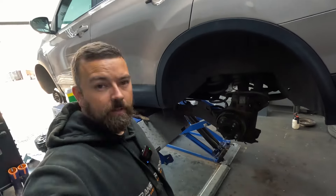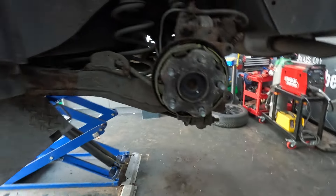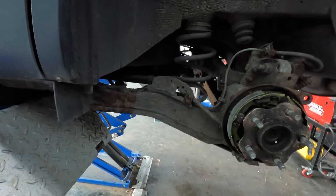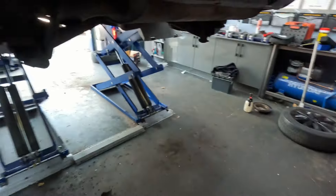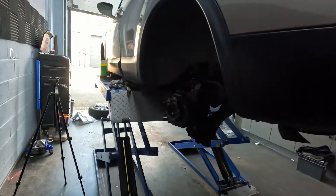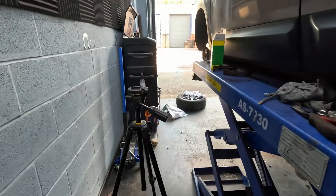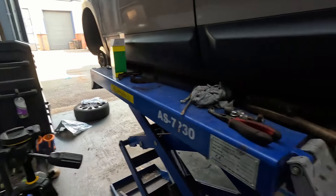All right, those clips are in — that side is all done. All the clips and springs are back on. Just going to put the new disc on, do what I did on the other side — bring the adjuster out until it touches and then back it in a little bit. Then I'll put the caliper carrier back on and this side's done. So that's the handbrake done on both sides. I'll test the handbrake, give it a pull inside and see if I can turn the wheels by hand. I've got the new wishbone — the correct one this time — so once that's done I think that's all the failures addressed.